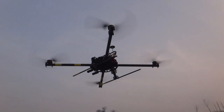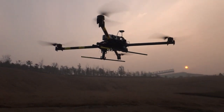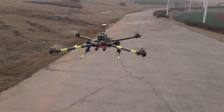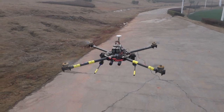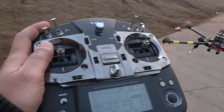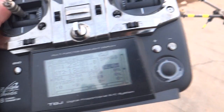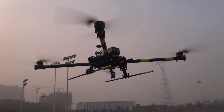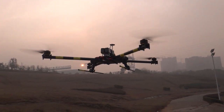These are 5000mAh 4S batteries in 2P configuration — that means two batteries tied in parallel. With some light cameras and gadget payload, I am sure this can give us a very good 20 minutes of flight time. That makes it a very good tool for aerial surveillance and search and rescue missions.